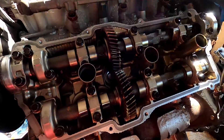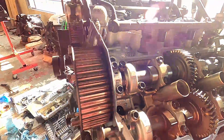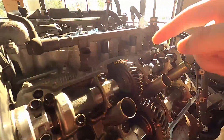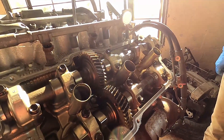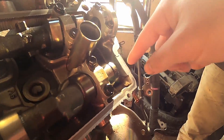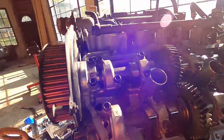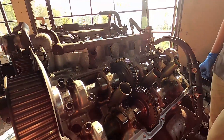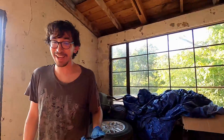This is the valve train head and cam area. There's a single cam gear that's gear-driven to the second cam, so it is a dual overhead cam setup. Alex has replaced the seals on the half moons down here, the cam bridges, and the full moons in the back, and he's now putting on the second valve cover. Learning a lot — okay, your time is over.